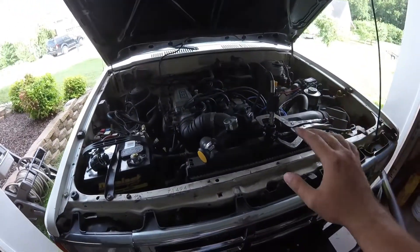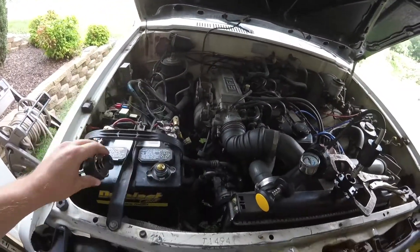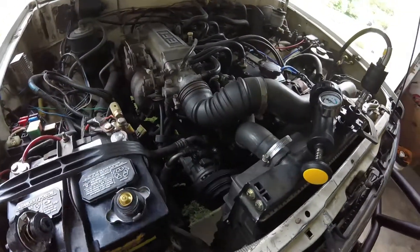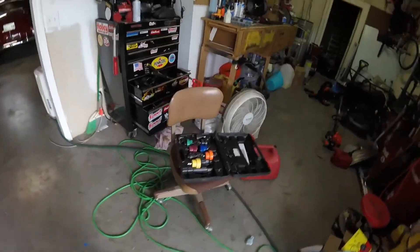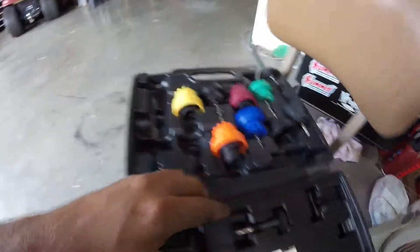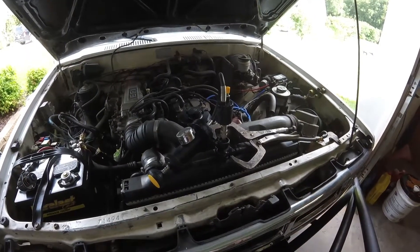Next thing is my 4Runner. Normally when I use a radiator pressure tester, I use these on Japanese cars, but for some reason mine didn't want to fit — it wanted to leak around the seal. This is a little setup I had to do — kind of ghetto. This is a Harbor Freight kit. It's been holding pressure. I put 15 psi on it and found one of the coolant bolts for the water pump that goes through the timing cover — the one that has coolant going through it — it was leaking through the threads. It wasn't really all that tight either. I used the smallest adapter and screwed it down tight. I had to clamp it with a C-clamp to get it to stay because it kept wanting to pop off — cheap Harbor Freight stuff compared to buying a Snap-on or Mac one. But for around the house, this works pretty good.